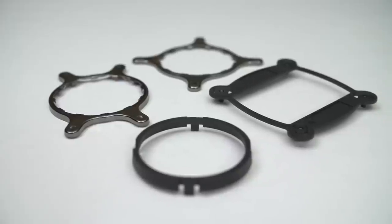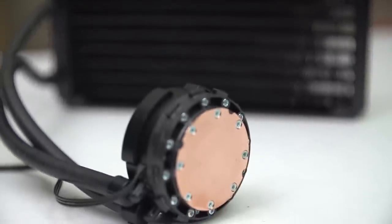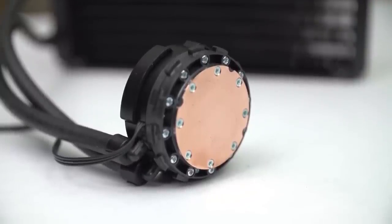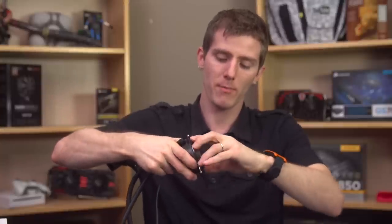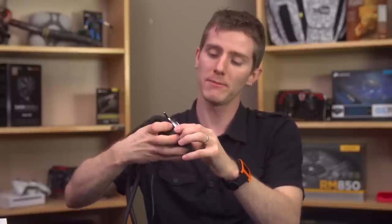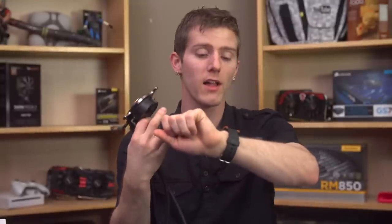It comes with a slightly updated backplate. This is an Asetek design, so it's not something we've never seen before, but the little pieces are a bit easier to slide. So whether you're mounting on LGA 1151/115X, 1366, or 2011, you're going to be able to get it in the right position quite easily. Although remember, 2011 has its own backplate built onto the motherboard, just like AMD sockets. For AMD hardware, you just get a hold-down, which can be swapped by undoing these four little clips, popping off the bottom ring, pulling off the hold-down, and swapping on the appropriate AMD one — then it screws directly into the motherboard's built-in backplate, giving you compatibility for both FM and AM sockets.